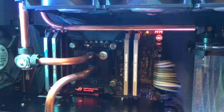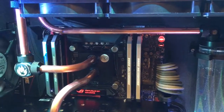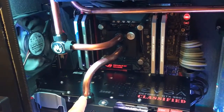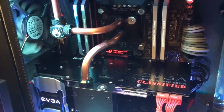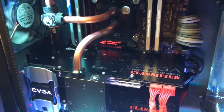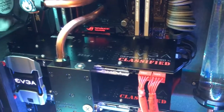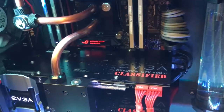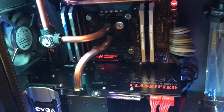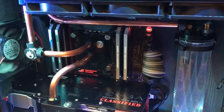The project I got done last weekend was the copper tubing that you see in the video. You just have to have the right tools, but it's very easy. These are the Primochill Revolver fittings for half-inch outer diameter — they were made for acrylic tubing but work just as well on copper. It's essentially an o-ring that gets squeezed into the pipe and holds solid.